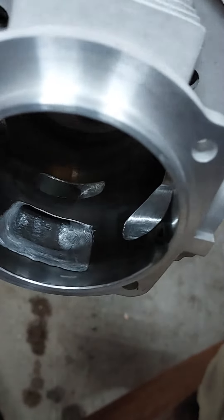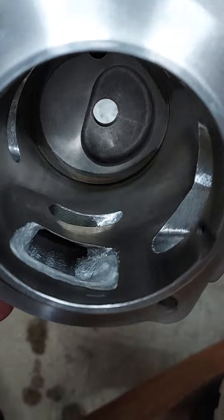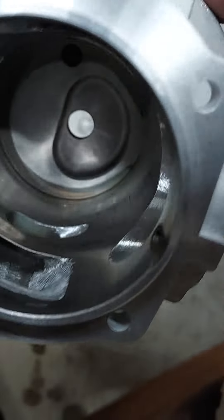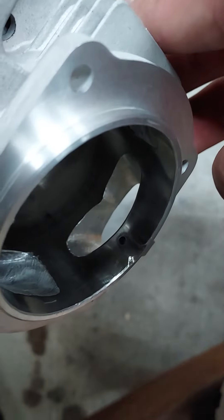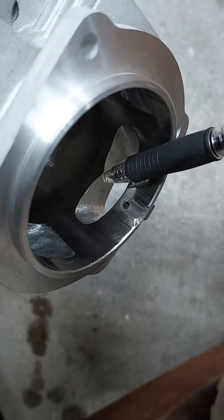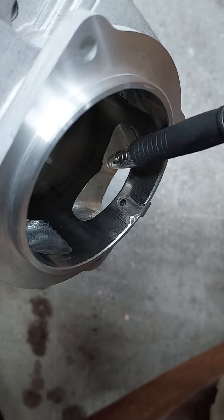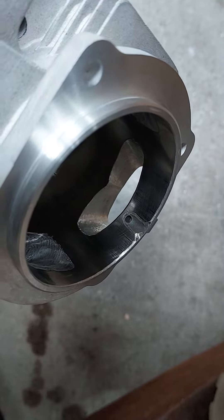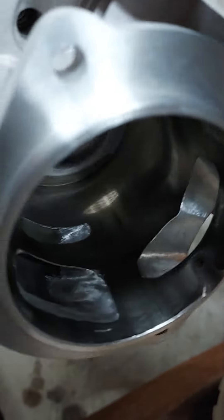I went back into the O90 jug and changed the porting up a little bit. There's the intake. You can see the piston wasn't coming all the way down to the top of the intake right here. So I decided to raise that a little bit and try the little double lung thing, and we'll see how it does. It seems to be something to it, so we'll give it a try.